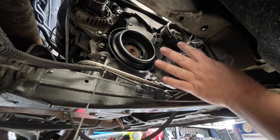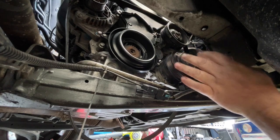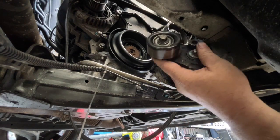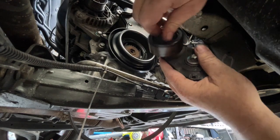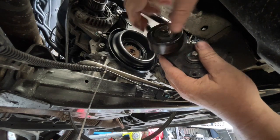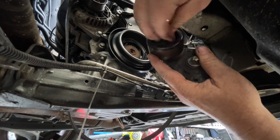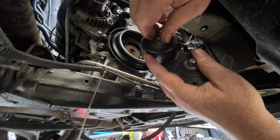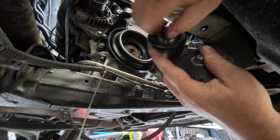I've just ducked around to the other side of the engine to finish over on this end. I'm going to reinstall the belt tensioner — I undid this to remove it and we'll tighten that back up once it's in place. Be careful: that bolt is a reverse thread, so don't mix yourself up.